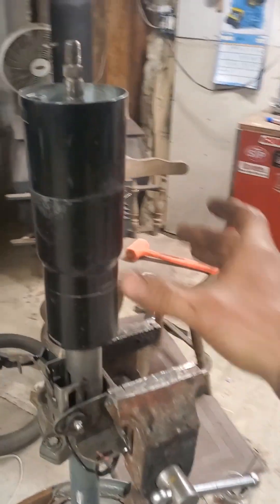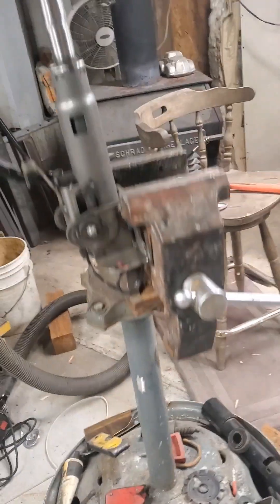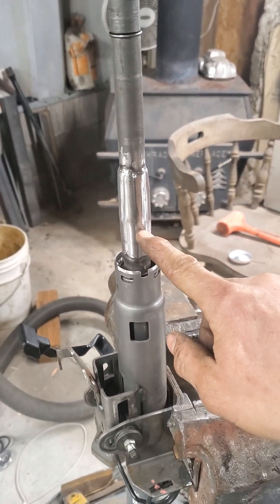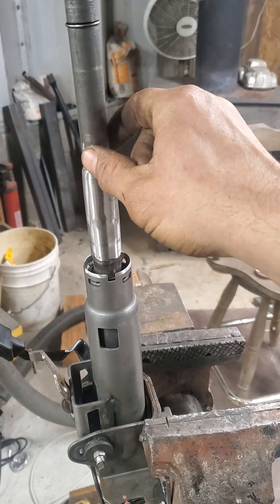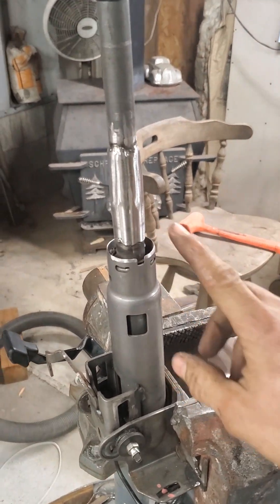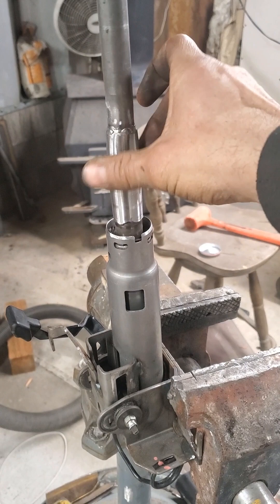What I would have done differently: the Prius shaft had a threaded spline on this side that I cut off for some reason. In hindsight, I would have left that on there, reamed the hole out a little bit bigger, threaded it for like a 3/8-16 bolt, drilled the hole in the Camaro shaft the same and threaded it for a 3/8 shaft, and then just screwed them together - I think that would have worked really well and been very straightforward. But when I cut off the spline portion, what remained had a taper to it, so the tap just kicked off to the side and I couldn't get it to line up perfectly. That's why I had to go through this whole workaround, and once I got all that together it was about 20 thousandths too big in diameter to fit in the sleeve, so most of the time I wasted was grinding it down to fit.